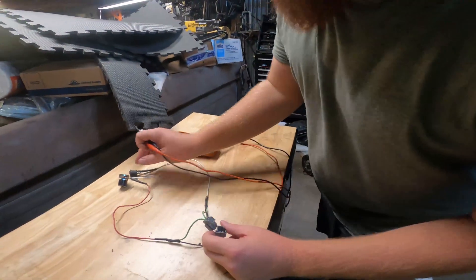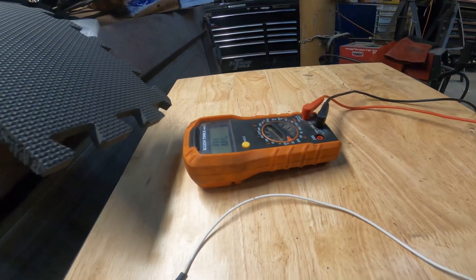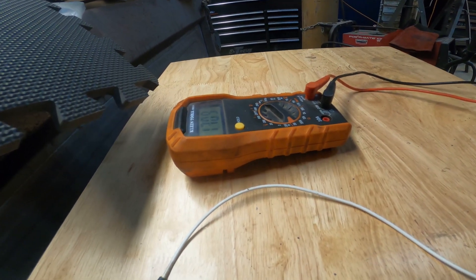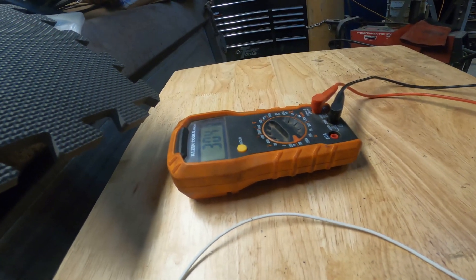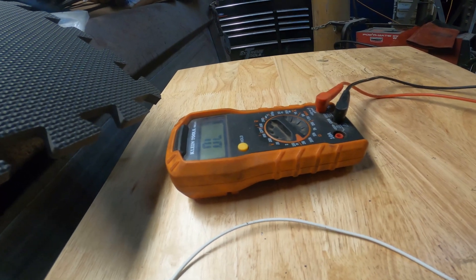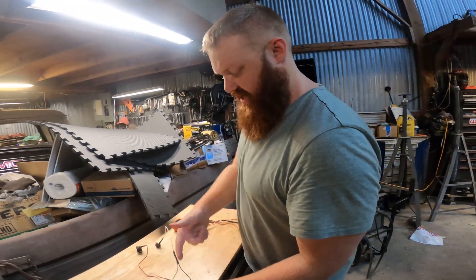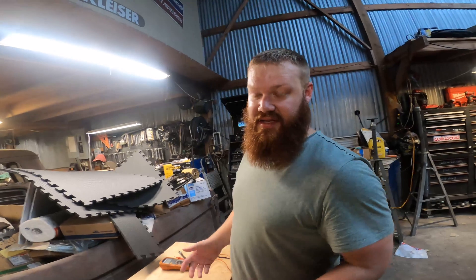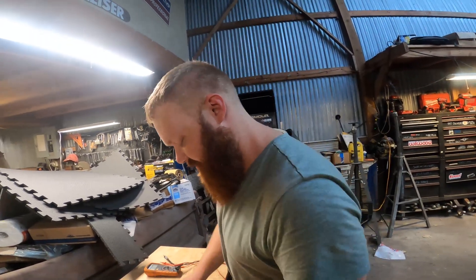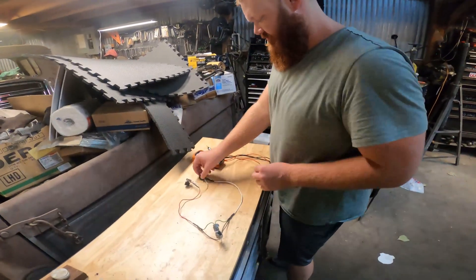So then we want to go back down to our pins here. The switch is turned on, so we would expect to see some resistance down here — and it's the same resistance. Right at 300. Now while you're still holding that, I'm going to flip the switch so you can see while it's plugged in, if you turn it off, now it's going to drop to no resistance. Back to factory setting. And the most important thing with that switch setup is this has to be connected. So if you were to wire this where the resistance is in line, then when you disconnect it your thermistor is not going to be connected anymore and you got no AC. So this allows you to achieve really everything you want — everything in one go.